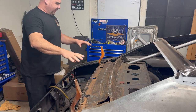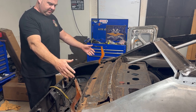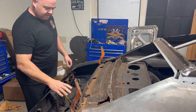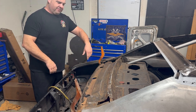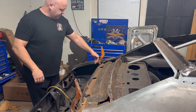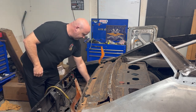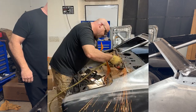As you can see, before this deck filler panel — I think that's its official name — I ground off these welds. They're all little pinch welds from the factory, and it's easier to just take a grinder and grind those thin, then take your cutter and just kind of hammer these out.